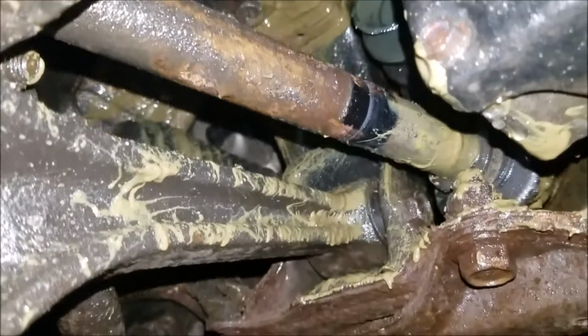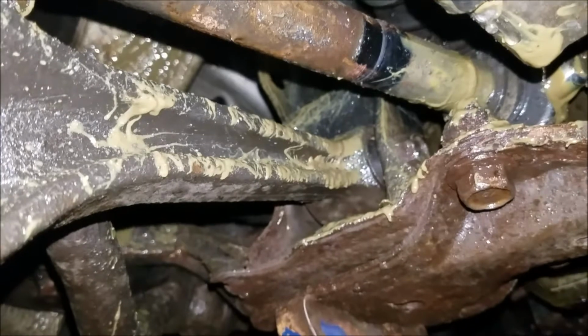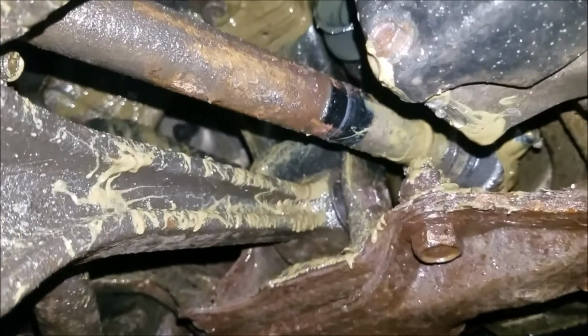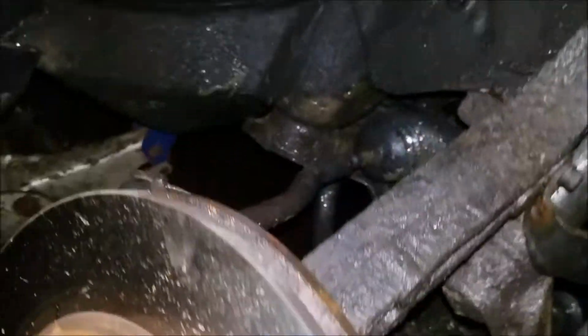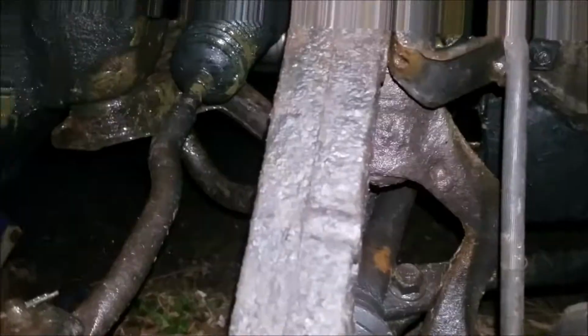With the 2001 Honda Accord, yeah, the ball joint, which is right here, is broken on this one. The owner got away lucky on this because only the drive shaft, which is that right there that's moving, was ripped out. It didn't damage the transmission. I don't think the transmission's been damaged, but I'm going to be replacing the ball joint and that axle.